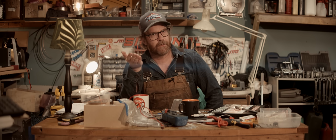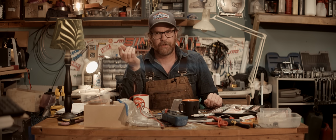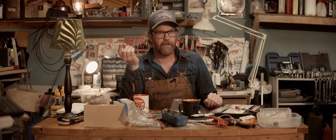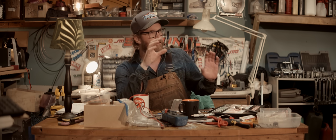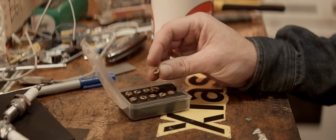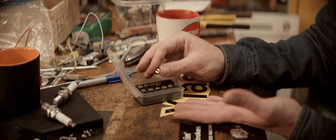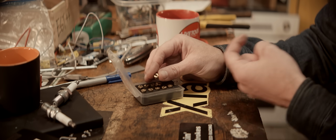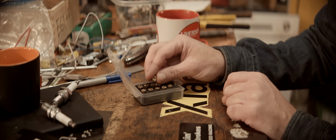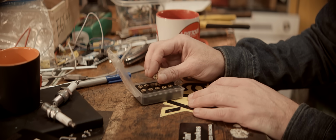Before we play more with ignition timing and before we start adding compression, I'm gonna either machine some heads, or actually I think JLC PCB will make some heads for me, inserts. So last time we drilled a jet out to 2.5mm. Now we're gonna drill one out to 3. This might take us into being restricted by the needle in the metering circuit versus being main jet restricted.